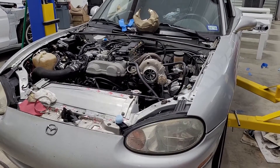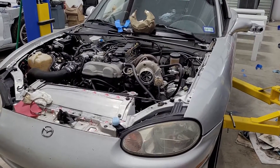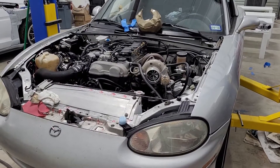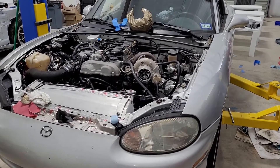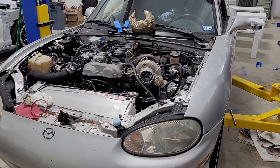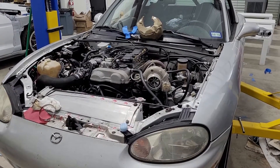What we never did was build an awesome compound turbo setup. If I had to judge all four setups, they almost progressively got worse. Honestly, the most fun setup was the first one with that GT28 turbo, because it just had so much power coming up in the mid-range — running that turbo up to 20-something pounds of boost at 4,000 to 4,500 RPM. This car had a lot of torque that was very enjoyable, especially with a manual transmission.